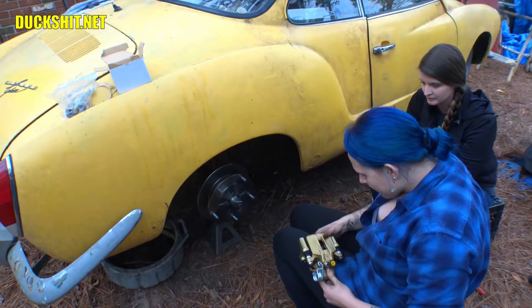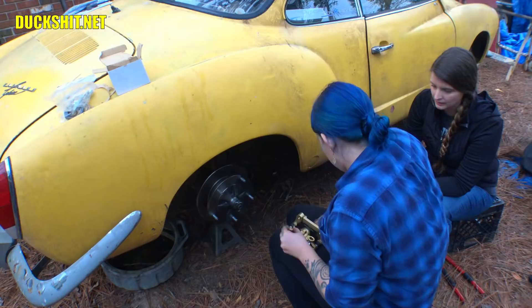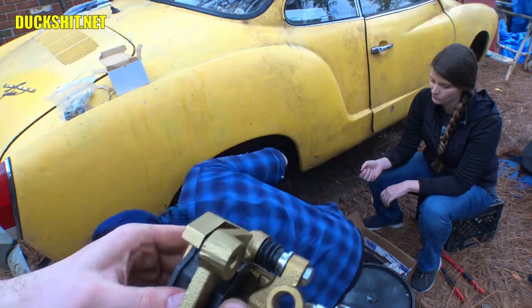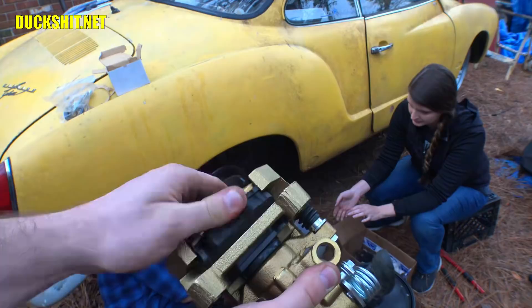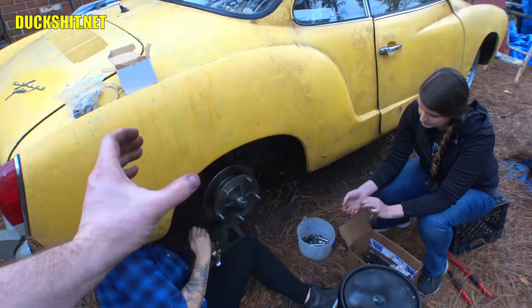The spring fell — oh, you hit it with your finger. Just push it down, squeeze it right down where it needs to go and press it right in place. She was worried because she knocked that out — this just goes right back into place. Sometimes these calipers need to be spaced over the disc because forward-and-back motion can cause a problem. If that does happen, you simply put a washer between the caliper and the bracket and space it out accordingly. Ruby needed spacers only on one side — the other side was perfect. What's funny is it took a few months but the disc started rubbing on the inside of the caliper, making a horrible crushing sound when I stepped on the brakes.